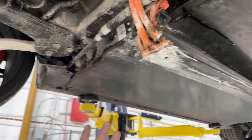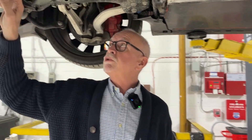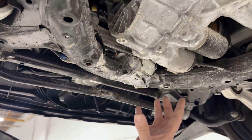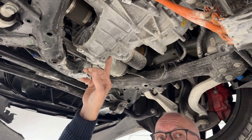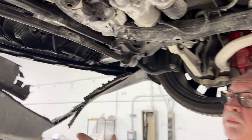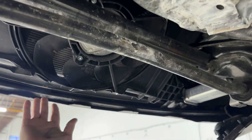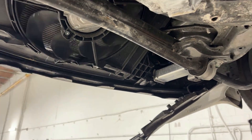So we have more things to test and check for. Beyond what we see here, we also notice that our front drive unit mounting bracket is broken, so this is going to need a drive unit. Cross member damage will have to be replaced, as well as our undershields and the cooling system up front for thermal management — we can see we've got a little leak here. The radiator itself will have to be replaced as well as the cooling fan, the shroud, and some components up here.